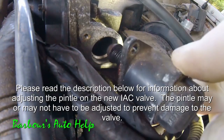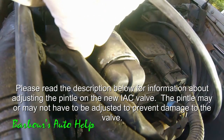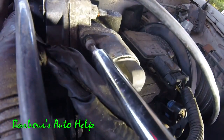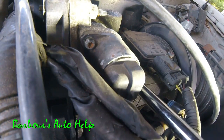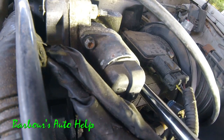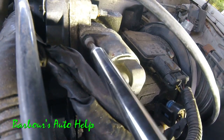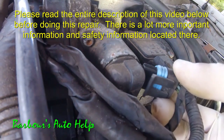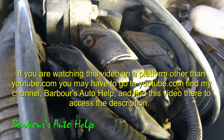Once you've done that, go ahead and put your new IAC motor in. Take your bolts or screws and start them by hand. Use both hands on this so you don't drop those screws. Get that one started, and before you tighten that one down, go ahead and put your other one in. Tighten both down. Replace your electrical connector, and there you go — very simple. We just replaced the IAC motor on a 2001 Pontiac Bonneville 3.8L Series 2.